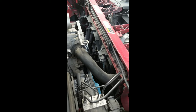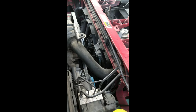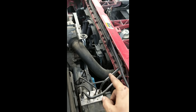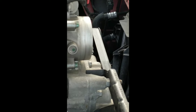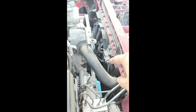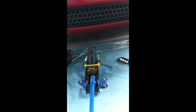Now we're going to remove the radiator fan. Start by removing the electrical connection. Then there are two 8 millimeter bolts — one underneath the radiator hose and another one by the AC hose over there. There are also some mounting brackets down at the bottom. After removing those and the electrical connection, you just lift her up a bit, slide her back, then up and out.